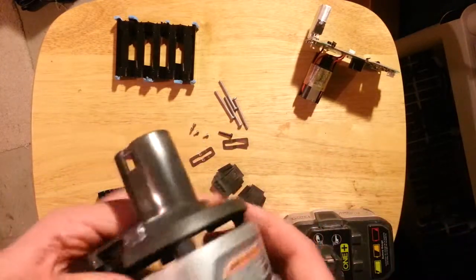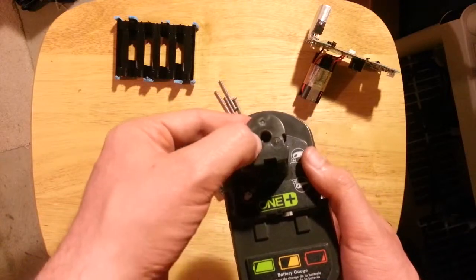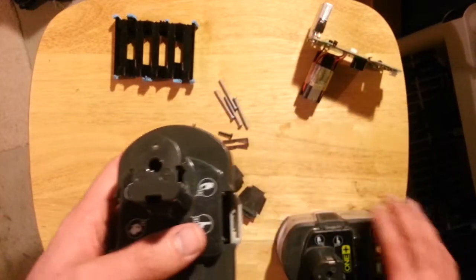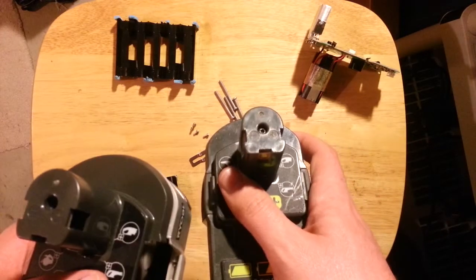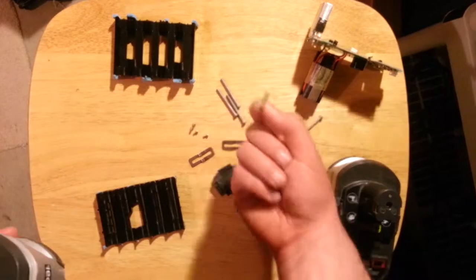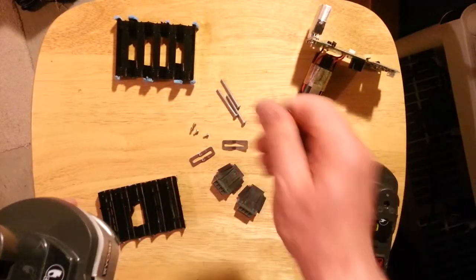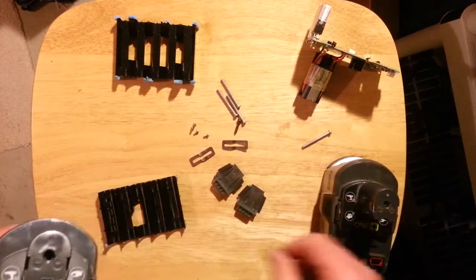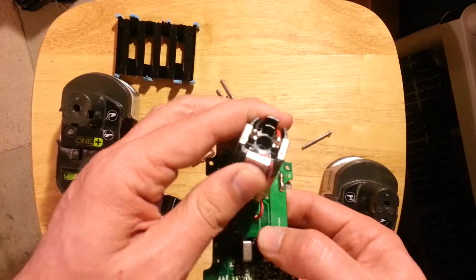One of the things I learned after the fact is right here on the top — there is a screw hole right there, and that's a standard Torx. You can see the screw in there, and you can see the screw that's left over from the disassembled one. So standard Torx — pull that out, and that releases the top of this here.